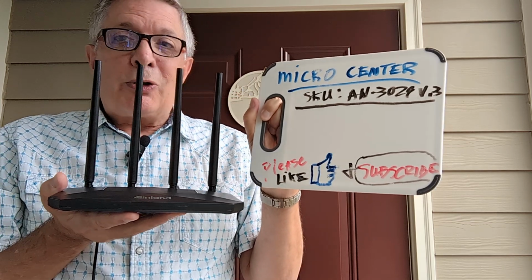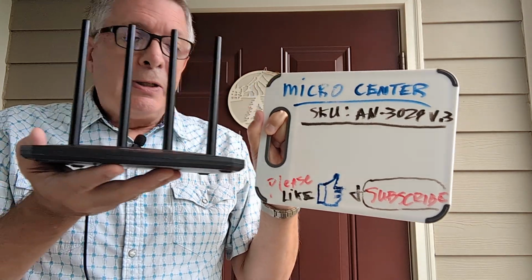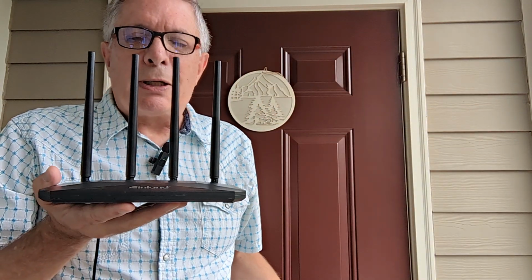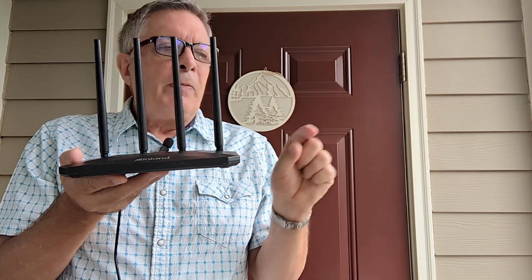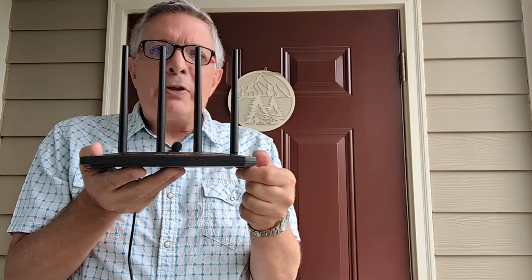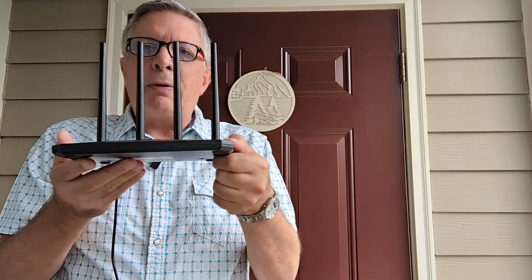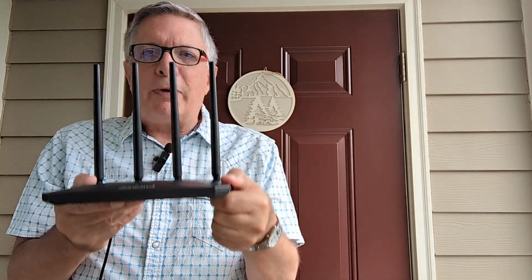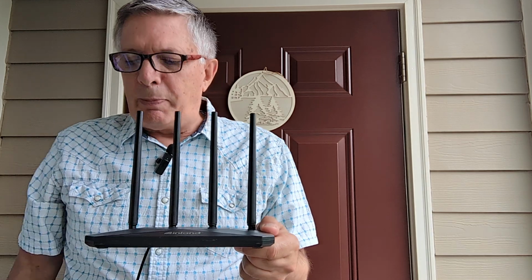And then your chore, once you buy it and bring it home, will be to move around the house and try to find a good spot for it, because these microwave signals, UHF signals, are very picky. You can move a small distance, half an inch, and you'll lose the signal. So you have to move it around the house, find a place that's convenient for you, and a place that also gets you the best signal.